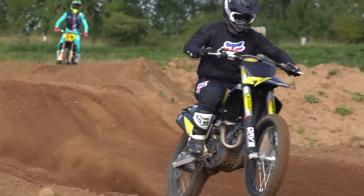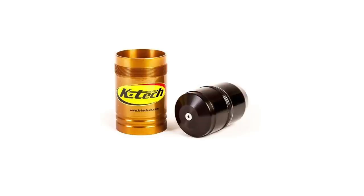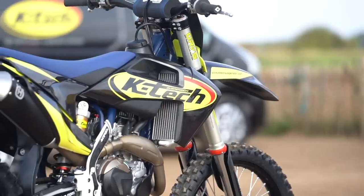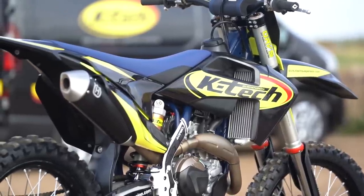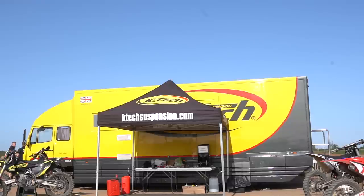On the rear of the bike, the biggest thing people will notice is the bladder conversion. The standard unit is a separation piston reservoir — a piston moves up and down in the cylinder, so on small movements you get friction from that. Our bladder conversion just compresses the bladder on those small movements, so there's basically zero friction. It smooths the bike out on all those horrible acceleration bumps — you don't get that judder from the rear. We've also fitted our own piston in place of the standard WP piston, which changes the way the oil flows and gives a much nicer ride overall.